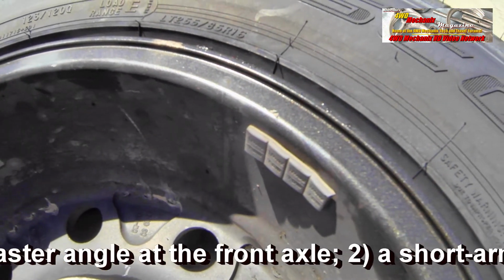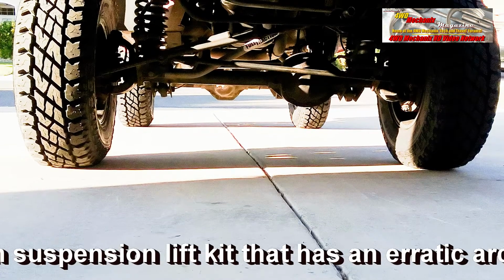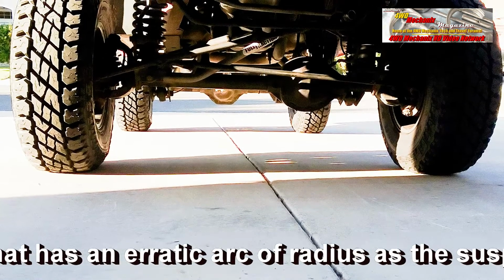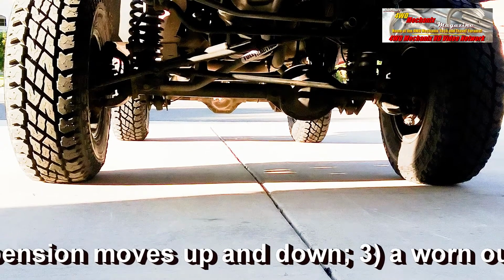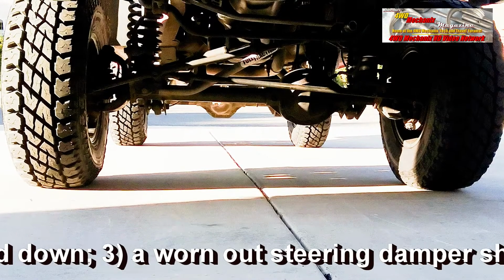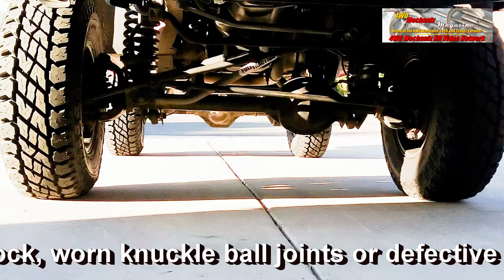When you're experiencing a shimmy, and this is a classic on the Jeep XJ Cherokees, called the death wobble, it can happen on any Jeep. Sometimes that's actually related to tires and the type of balance that was employed. The shimmy is the weight of the imbalance trying to pull on the steering and causing the wheel to vibrate.